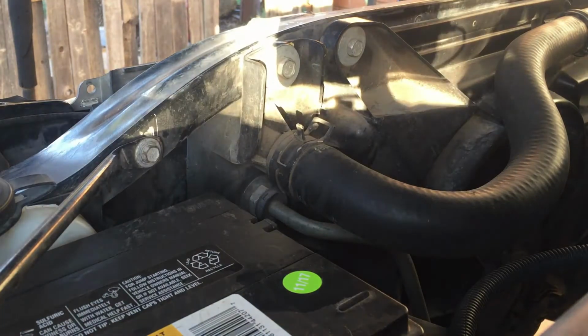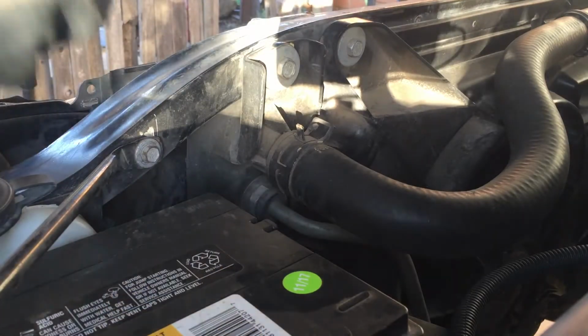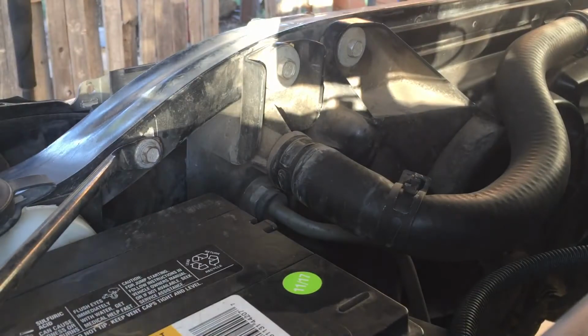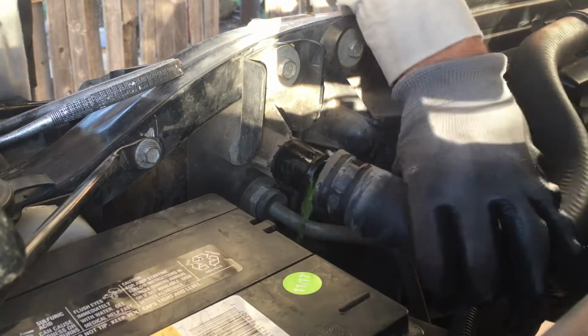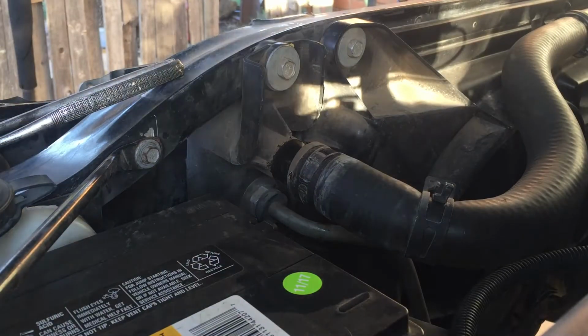Okay, let's start by taking this off. I'm just gonna use some pliers. I've got that special tool, but seems like I'd have a harder time right now. This would be a lot quicker. And I'll open these pliers and break that seal. And it don't matter if you mess this radiator up, because it's no good anyway. You probably sell it for aluminum. Let me see if it's gonna squirt anything out of here. A little bit of coolant. Let me do the other ones.